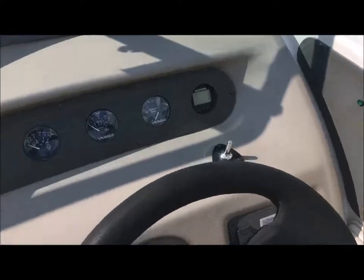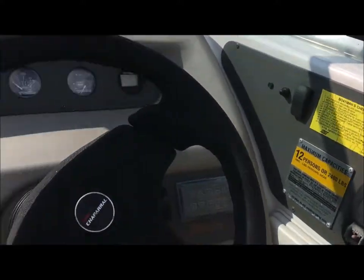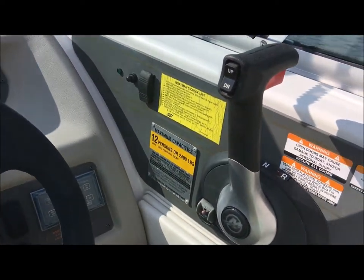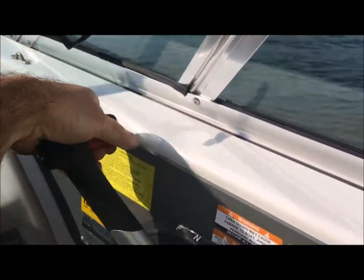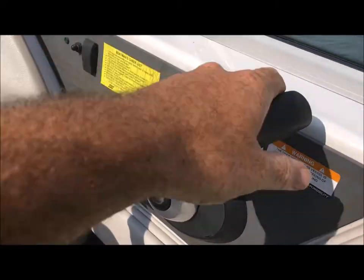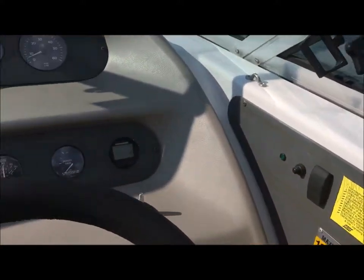Three things that won't start: click click click — it's a dead battery. Turn the key over, nothing happens — it's in gear. Turn the key and it just turns and won't fire — maybe out of gas, or the kill switch is most likely off. Shifting is real smooth — there's a definitive catch for forward, neutral, and reverse. Throttle range is beyond that. If you need to choke or prime it, push in the button and push it forward. Tilting trim gauge does work.